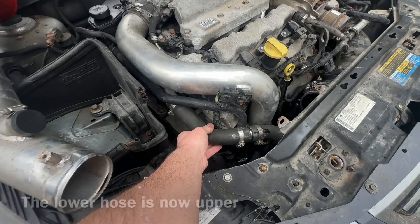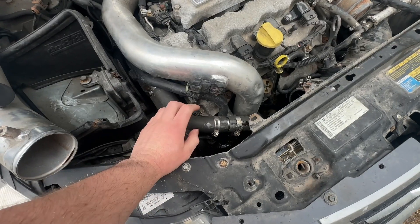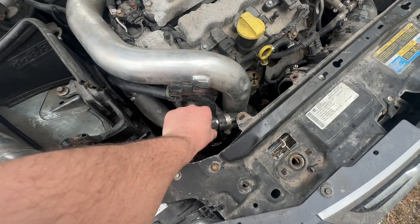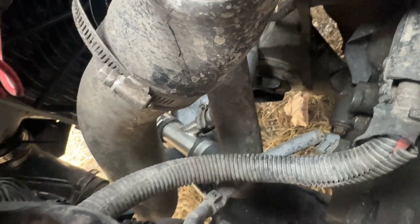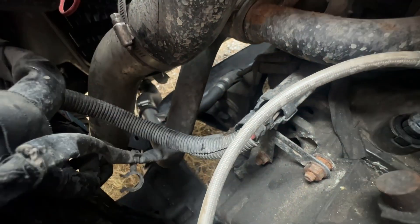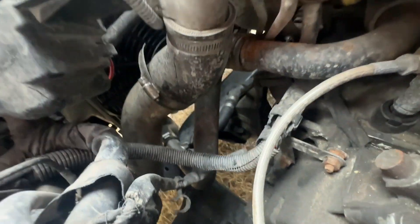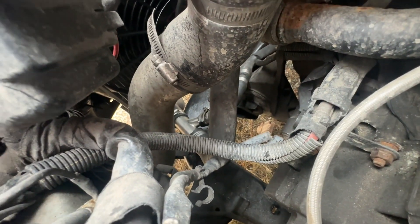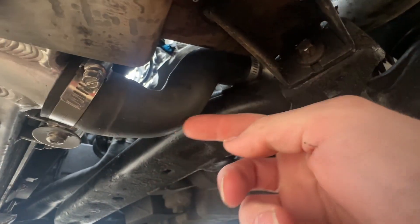As for piping, we actually swapped hoses — the bottom hose fit almost perfectly but needed about two and a half inches of length removed, so we used a connector. On the bottom Y you can see the furthest-over connection goes to the oil cooler, teed into the driver's side to help keep the oil cool, and that also helped us remove about eight inches from that tube. The normal bottom-side feed pipe connects to about three-quarters of the way and then we snipped it, and to get perfect fitment we used the S-shaped elbow part of an upper radiator hose, cut to shape — it goes up and back over the subframe.